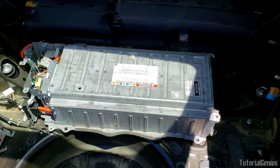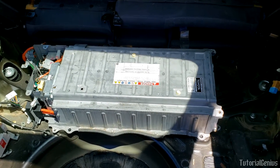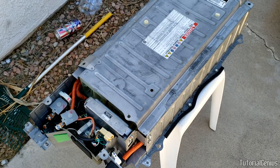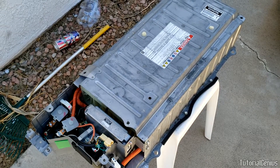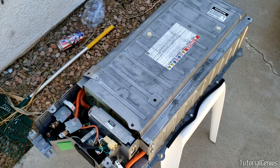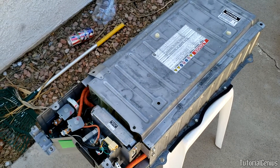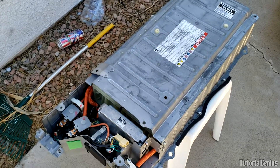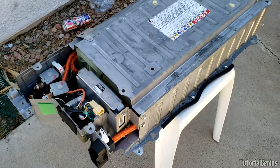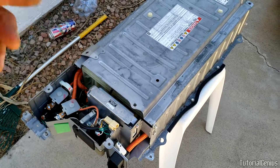With those five bolts removed, the disassembly is complete. It's quite heavy to remove so be careful — make sure all the connectors are pushed out of the way before you drag or lift it out so you don't break any of them. Here it is — the hybrid battery. It's around 100 to 120 pounds by feel, so about 50 to 55 kilos — it's a big boy. Whatever you want to do with it from here is up to you. I hope the video was useful; please support the channel by liking and subscribing, and all the parts used will be listed in the description below.